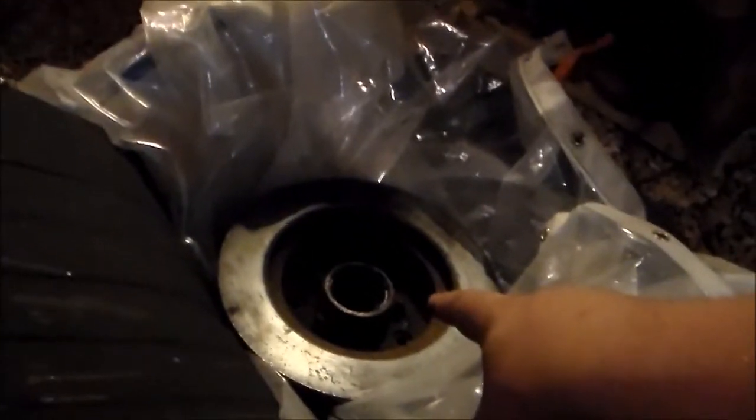I have it off already. This is the 91 Capri style. This is a beast — it's friggin heavy. What needs to be cut off is the ring itself from here, then this needs to be turned down, and this needs to be turned down to fit the Camaro rotor which is over there. What I found is they're actually the same size in diameter, but the actual dual piston Camaro calipers — the calipers with the brackets and the rotor — weigh less than this does by itself.